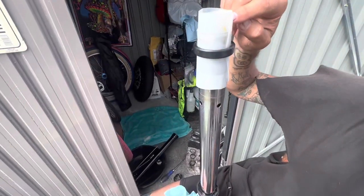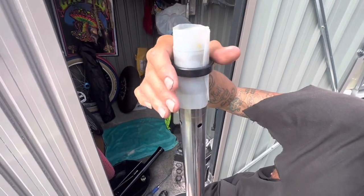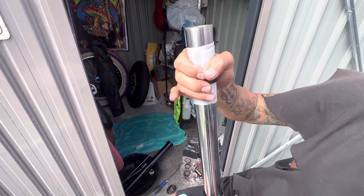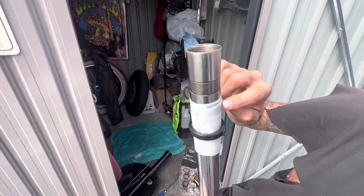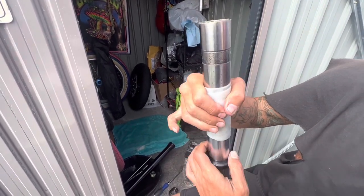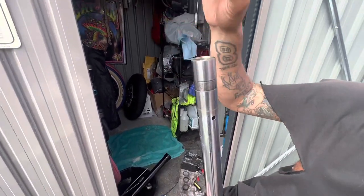This is the seal. Here's the seal — you just take this, twist it, put this on. You use this to get over — there are some little humps right here. You don't want to scrape your seal on those, and this kind of gets it over. Once you get here you can just work it on down. Beautiful. And this is a seal buddy — you can make this out of a milk carton. That one was handmade by him.